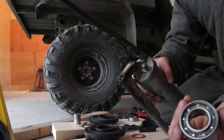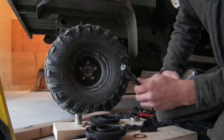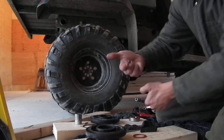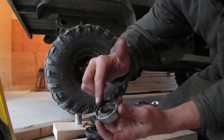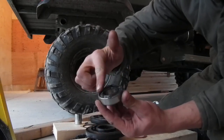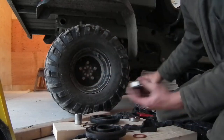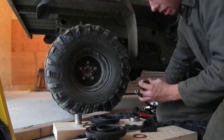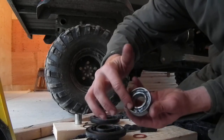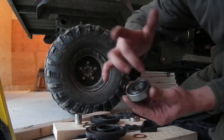You're going to need a grease gun or just some sort of grease. Just squeeze a bit of grease out here. Then you got to get your hands a bit dirty — if you don't like getting your hands dirty, use some rubber gloves or something. You just pack your bearing full, keep taking grease, and run your finger around to get the bearing full of grease.